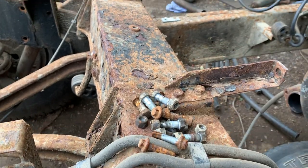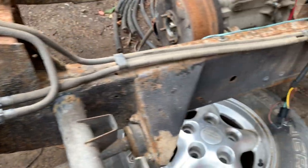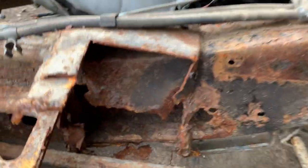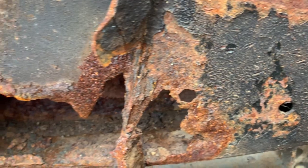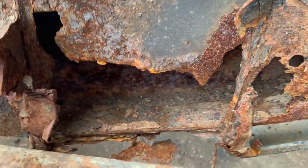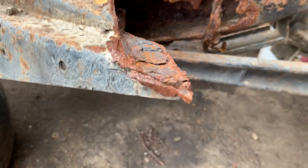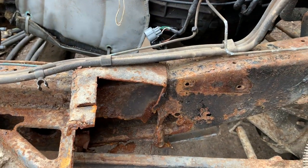This side of the rear body mounts isn't too bad by the look of it, but we've cut the outrigger off. You can see in here what we found on the main part of the chassis when we cut the outrigger off — it was all covered up with a mixture of tin and filler and all sorts of things. Absolutely dreadful. It didn't have that short an MOT on it. We've cut off the remains of the outrigger.